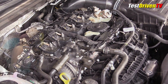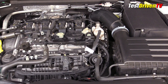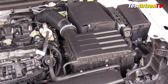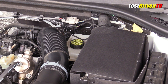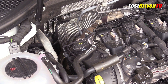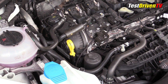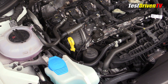In spite of all the high tech, servicing the engine is actually pretty straightforward, in spite of the fact that this is one tightly packed engine bay. This starts with an air filter right up front, though getting into it does require some tools. Next to that is the ECU and the main fuse block. Behind those is the battery, neatly wrapped in a thermal jacket. Reaching and checking the brake fluid just to the left of the battery does require a funnel, as it is buried down there just a little bit. On the passenger side, neatly grouped, is a coolant reservoir and the windshield washer fluid. The oil fill cap and the oil dipstick are on top of the engine at the passenger side, and the oil filter is also conveniently located on top of the engine for changing.